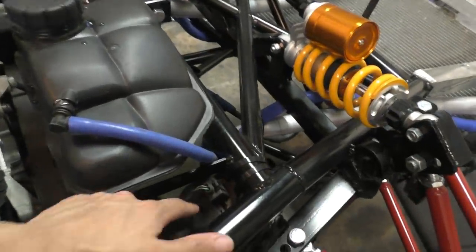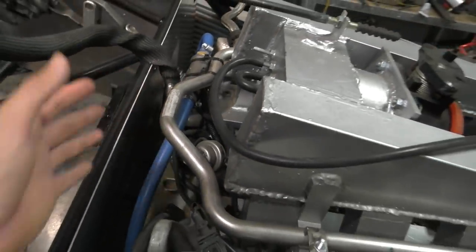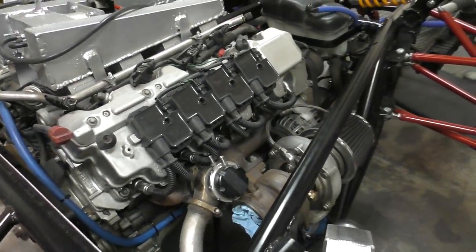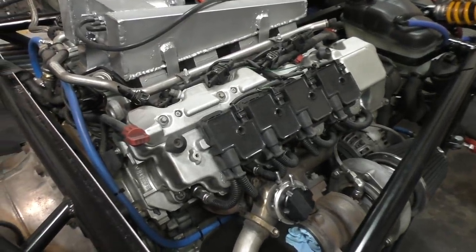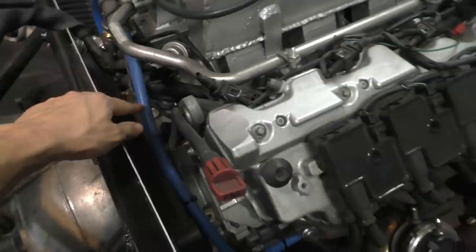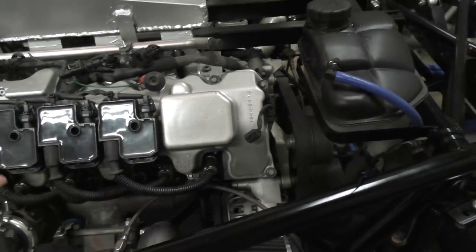For the second pump needed for the cooling system, I've mounted it here — this pump circulates coolant around the block. The coolant comes out of the head, goes into a T-fitting which divides it into two paths: one line goes through one turbo and one goes through the other turbo, and then from the turbos it goes to this pump, which pumps it back to the block. The parts look a bit industrial because I sourced everything from Fluid Lines, but they made it really easy — I gave them my pressures and temperatures and they supplied all the silicone hoses, connectors, and fittings.